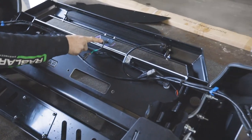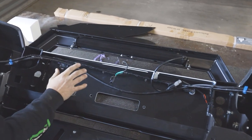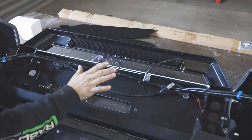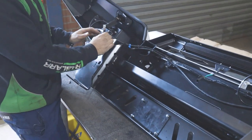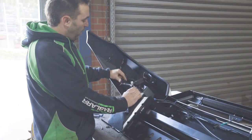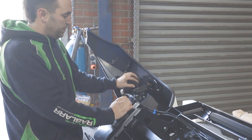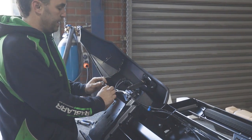Camera bracket mounted there, light bar, everything. The bolt kit for the bar has new bolts, so even the light bar and everything, stainless hardware for the camera, everything is supplied. Don't reuse anything from the light. If you're fitting driving or fog lights, now's the time to do that too, obviously. Bolt them in, wire them up. Whatever brand light you've used, you obviously need to connect that into the factory fog light loom so that it'll work on the stalk as per factory.